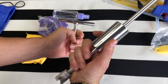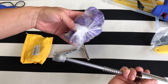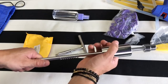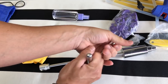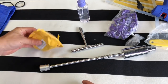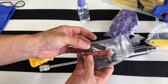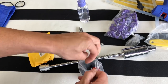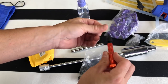This is actually the puller — this is what removes the dent. What you do is glue these little pull tabs, and there are all different sizes depending on what kind of dent you have. You glue one of these right onto the car, hook it around here, give it a couple taps, and then the last one you just tap it out and it pops out. This is also a grab handle you can use if you want to manually pull a dent out. There's also a little bottle of alcohol. I also purchased extra a hammer kit — once you pull the dent out, this is what you hit it back with if it pulls out too much. It was about $8.99 on Amazon, and it comes with all different kinds of tips.